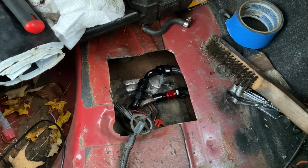Key on. This car is not like a GM at all. It has a negative trigger instead of a positive one for the fuel pump. This car also has that constant control relay module. I'm not sure if I've mentioned that or if someone else has. It's like a big giant relay box up front. They're known to go bad. So I was just using that to trigger it. It would trigger at 12 volts, then it would drop to 6 volts.